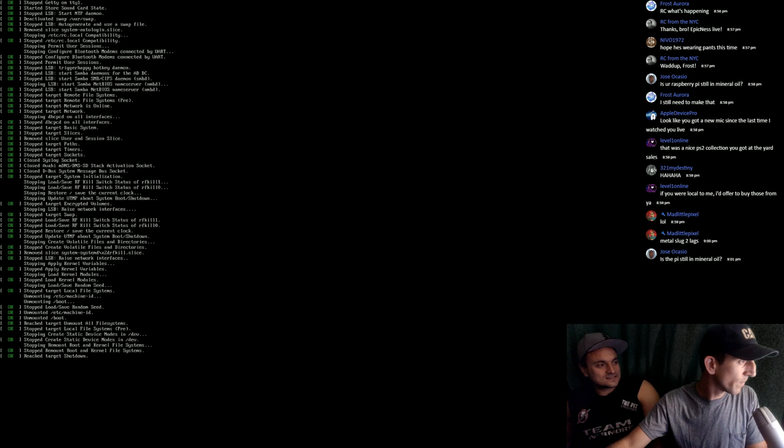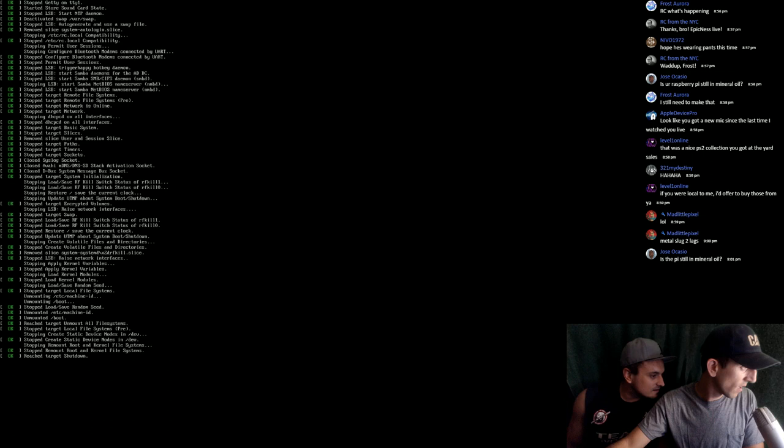All right, we got the file. We're going to go 1.3, GPU mem at 400, ARM at 1.3. You don't need the top part. Yeah. Line 42. All right. config.txt. You should open it in a text editor. Yeah, text editor, WordPad all day. Line 42. There you go. Delete that one. Just the top part. Yeah. Delete those three lines.